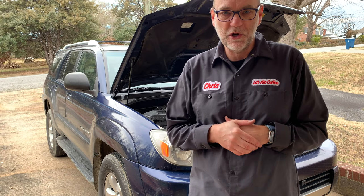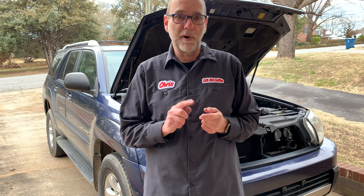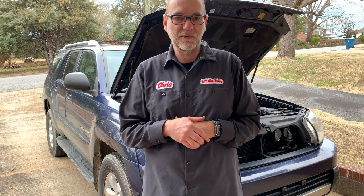You can get those parts easily at your auto parts store. The tools I used were a crescent wrench and a little white lithium grease, though that's probably optional. I used a half-inch deep socket to put the new ball socket screws in the hood and the frame of the car, but that was just to speed it up. You could easily put them back in with the crescent wrench that you took them out with.